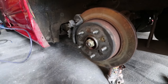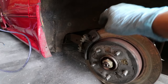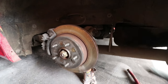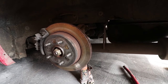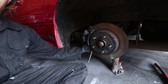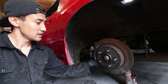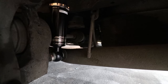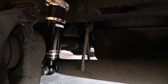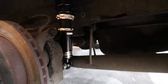While I'm here, it's worthwhile checking all the bolts and things. The brake caliper actually came loose because one of the bolts just came off. Doing a quick nut check — surprise surprise, the lower brake caliper bolt is loose. It's a good thing I decided to do a nut and bolt check, because the four bolts on both sides of the half shafts were loose — like really loose, you can just turn them with your fingers. So that's a bullet dodged.